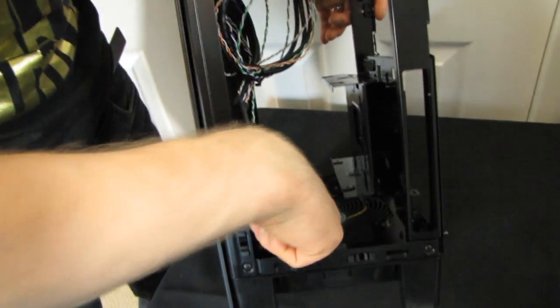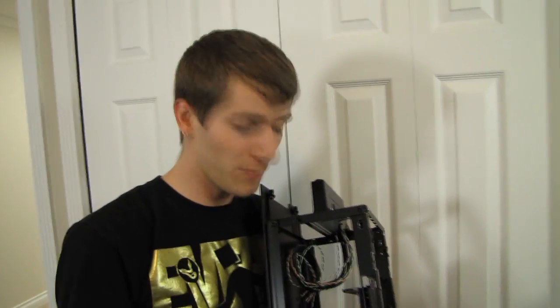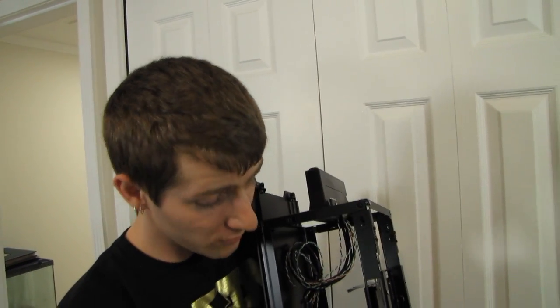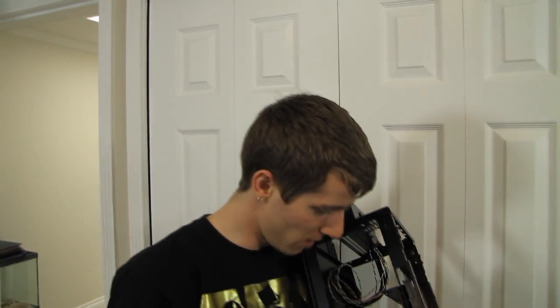Check this out. So it's a 140mm fan in the bottom here, but they put 120mm fan mounts here, here, here, and here. Why did they do that? Because they left room for you to install, and they even recommend, look, if you're going to put a high-performance CPU in here, throw in a liquid cooling radiator. So if you use a slim radiator, such as a Corsair H60, you can orient the tubes here and run them straight down along the back of the video card over to your CPU socket, which means that the cooling in here doesn't have to be mini ITX level cooling. It's off the floor by enough that you're going to have ample airflow going through that radiator, and yeah, it's just awesome. They really did just think of everything.